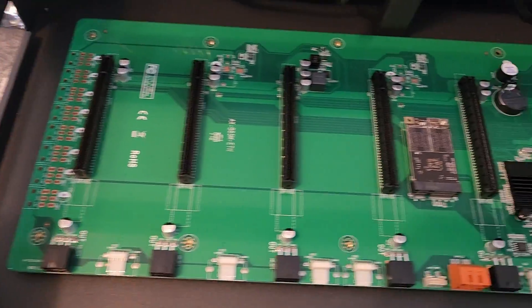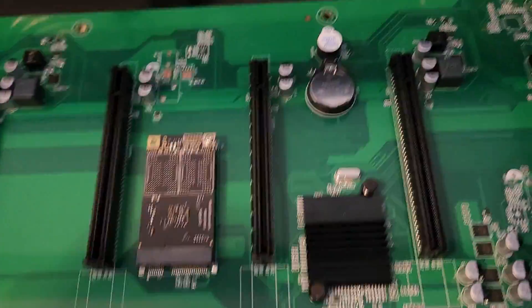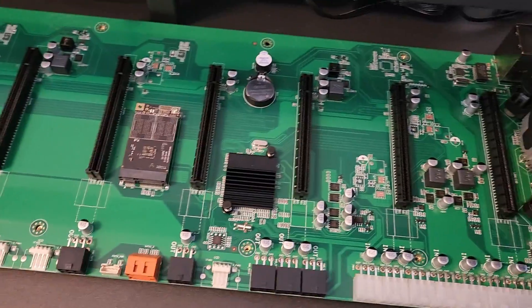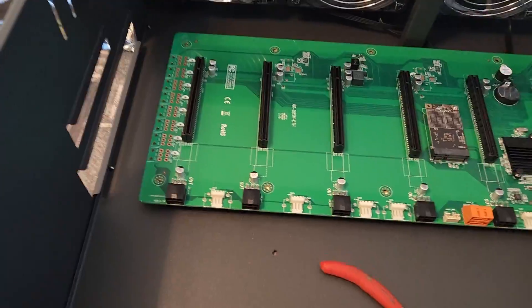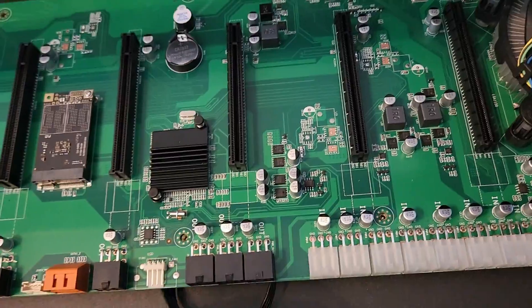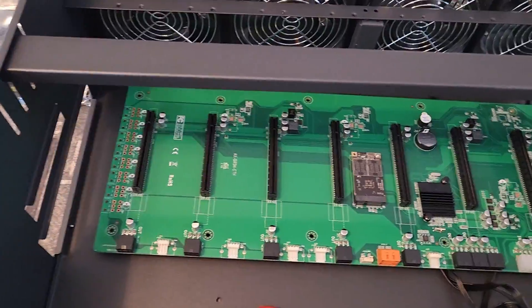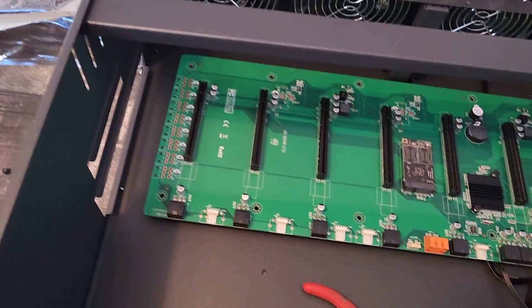It mostly lines up in here, which is cool. I know the GPUs are going to go on this rack. One screw didn't line up which messed me up a little bit, but I think that's all right. Overall this is really, really easy to build. When you put this in, don't forget to run the fans under for the fan hub — I did and it was annoying to fix. So far it's honestly not that bad to build.